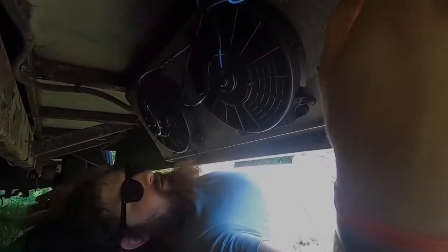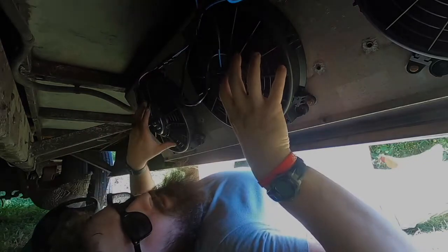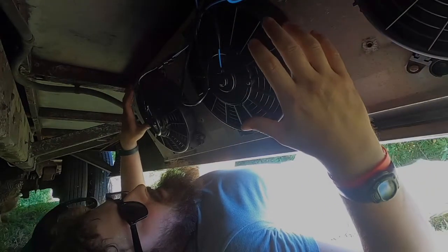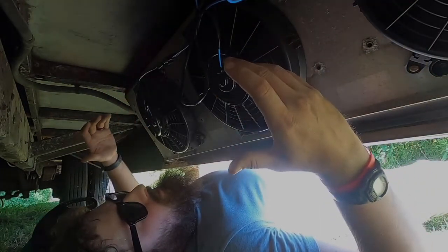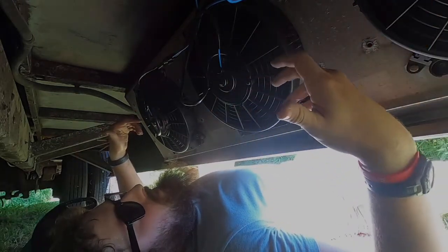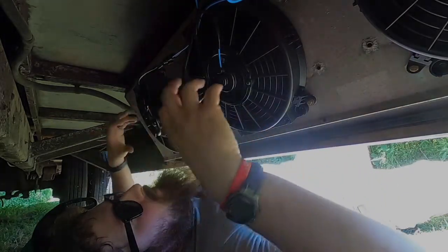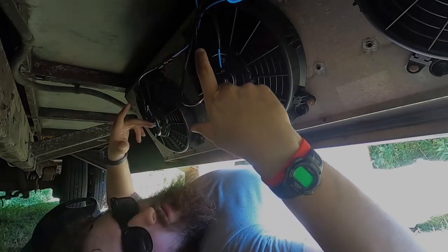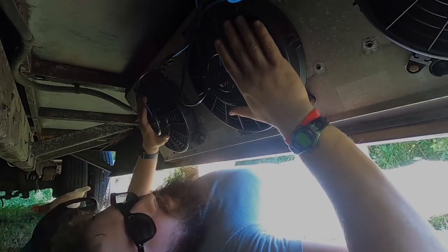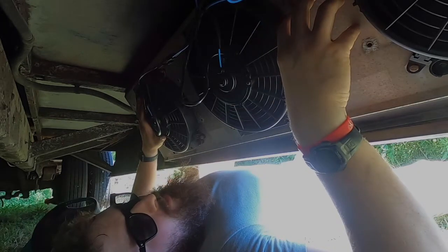We're going to try it. My new thought process is that these fans are spending all their energy shoving stuff out, and there's a skirt on the other side. As wind goes up and around the bus, we just need to move air efficiently across the coils. If I flip these around and have them pull, the grid on the other side with air going on the outside of the skirt would get pulled in anyway — and maybe it's just too much work for them to push. So we're going to flip these and try the AC again.